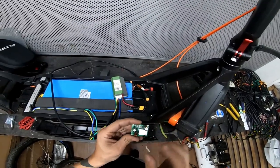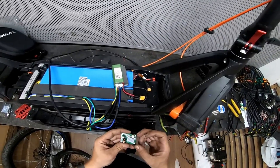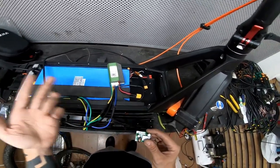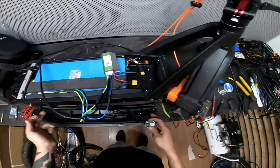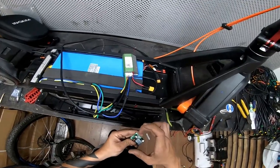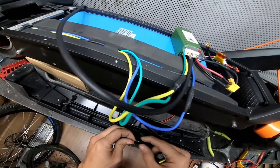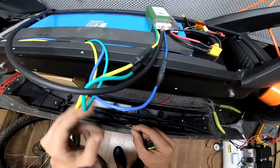It's really simple. You have output and input. On the input, you take the battery voltage and solder it to positive and negative on this side, the input, and on the output it will give out 5 volts. Pretty simple, right? So all of the lights, the rear and both of the front, we're gonna wire onto the output terminal. Check out the colors. Black goes with yellow and green goes with red. That means all of the LEDs on the rear light will be on.